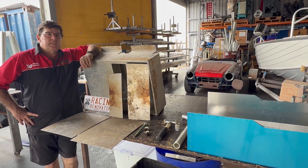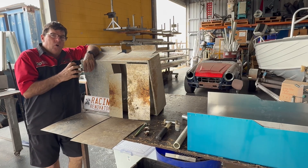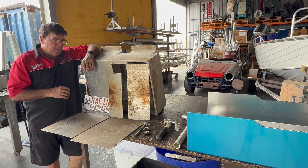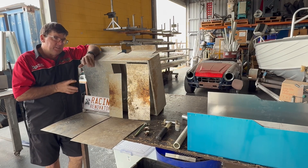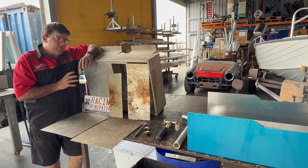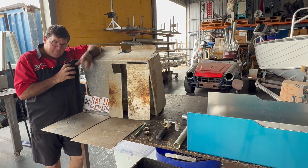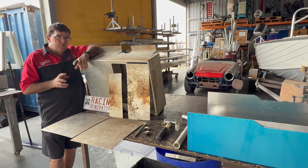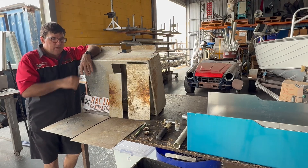I've also been asked whether putting an anode on an aluminium boat is a good idea. I did some experiments when I worked for a pearling company for 15 years — we found no value added by putting anodes on the boat. It actually ate severely around the anode rather than eating the anode itself. We do have anodes on our outboard motors though — let's go have a look.